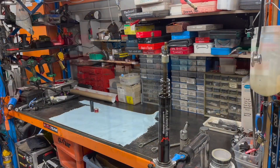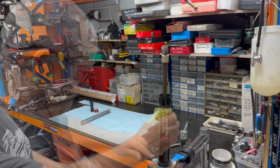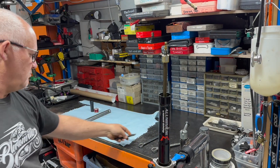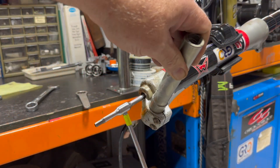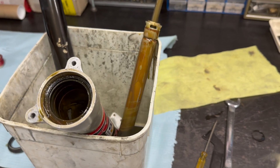You can see that rebound rod has wound itself out a little bit — just wind that in to keep it nice and safe. Remove your open-end wrench, slide the preload spacer off, and then take the spring out. I've got a rag there because you always end up with oil on it. Remove that dust seal down the bottom — I'm doing that with my tool from Motts. After that, get rid of that little clip to access the fork seal, then remove the fork leg — all shown previously. One thing I didn't cover last time: if you want to hold that leg tight, stick your front axle in there and that gives you a way to lock it from rotating while you're undoing that bottom screw.